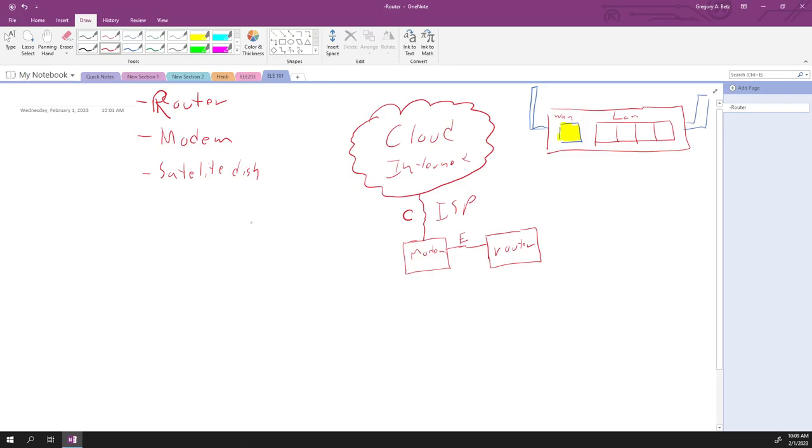As part of this all-in-one router, it's actually three different devices. You have your router, which is for directing traffic. You also have inside it a switch, which allows you to connect multiple devices to the router — that's what the LAN ports are. It could technically be what's called a hub — a hub is a dumb switch.